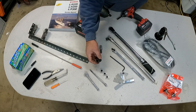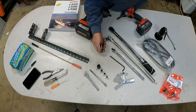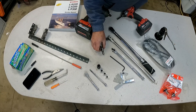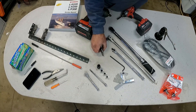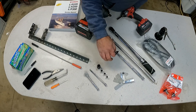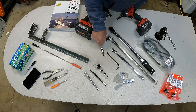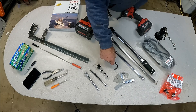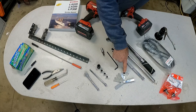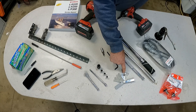You'll need a 14mm socket to remove the flywheel bolts. This is a 10mm Allen key, and you'll need that for loosening the tension pulley. You'll also need another Allen key to hold the tensioner once you have the tension removed — I'll show that in the video. A feeler gauge is for positioning the timing belt guards the appropriate distance away from the belt when you're done.